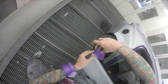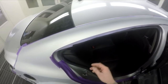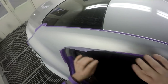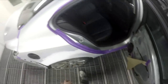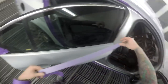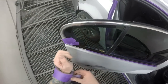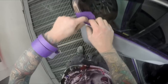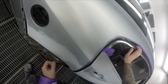I used to spend all this time masking everything down, false-edging the whole way around, and double up the masking tape, but it just takes forever. As I say, this is all you really need to do on your door jambs — it saves a lot of time. There's nothing wrong with a bit of back masking on the upper door jambs as long as you don't load your paint up under there. Even if you did spend all that time taping the rubbers down and using false edge masking, it would still build up. I've refined my methods over the years and I stand by them — they work for me.